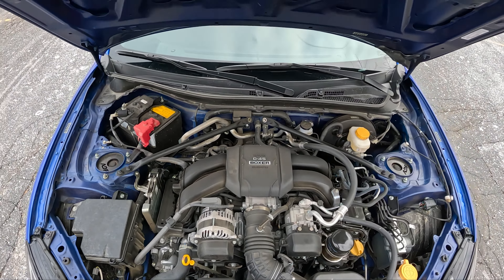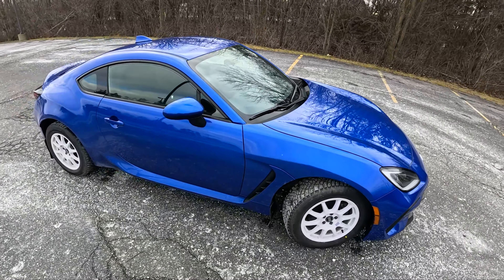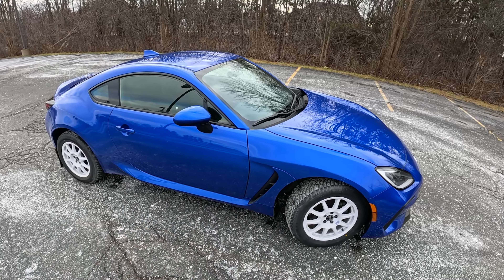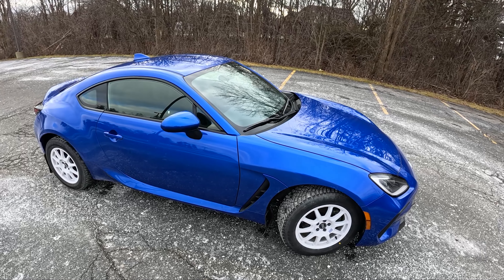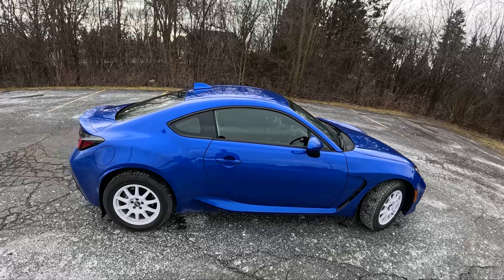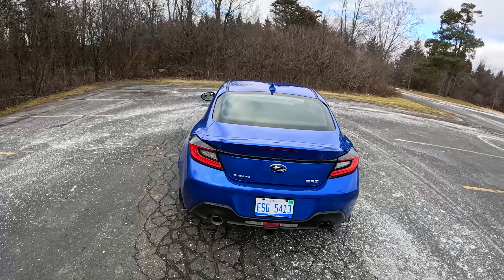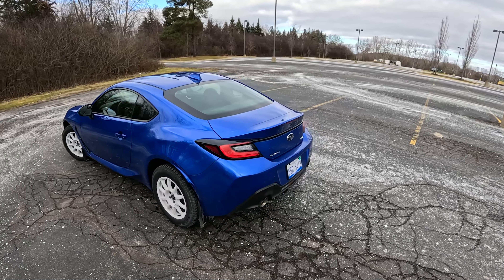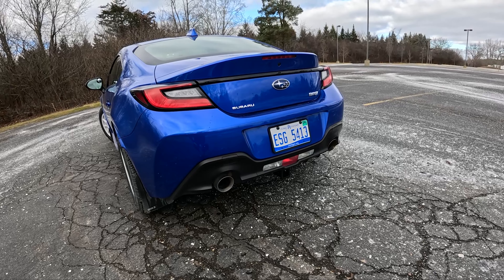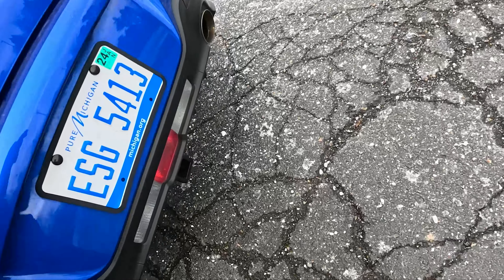This is a first-gen header — you can see it down there, it's ceramic coated. The install was pretty easy, pretty straightforward. The only problem is that the overpipe connection, the flange, is at a little bit of a different angle than it should be for the second-gen car to connect to the exhaust. So I had to put a couple of gaskets in there and some RTV, and between those two it seemed to make a pretty good seal, but it was a little bit tricky to get installed correctly. We'll throw some exhaust clips in this video so you can hear it with the MRT Street Touring Axle Back.